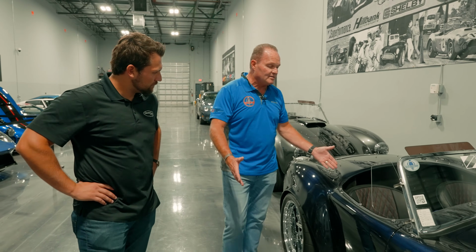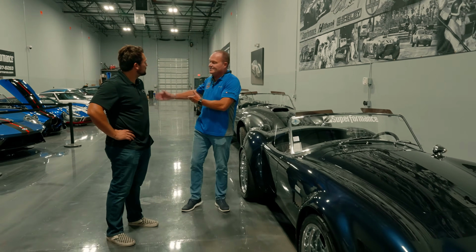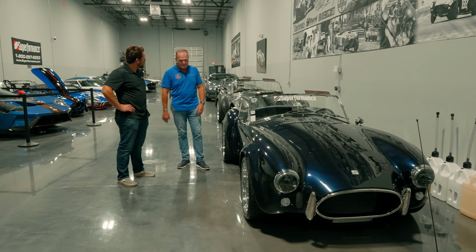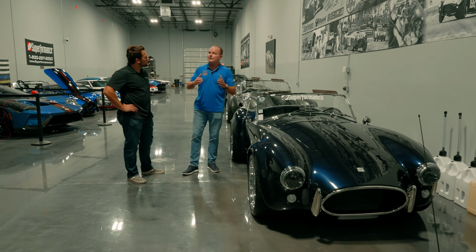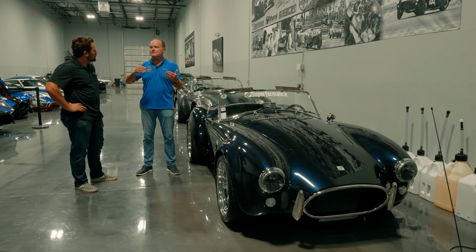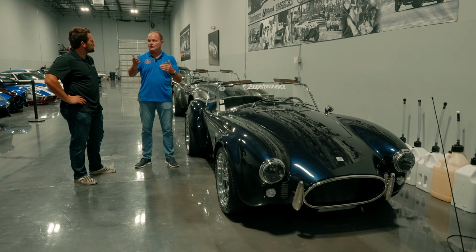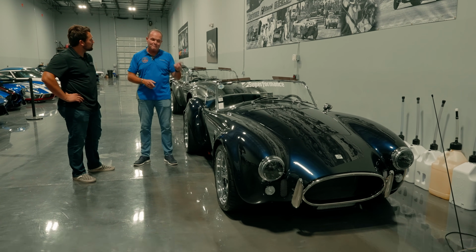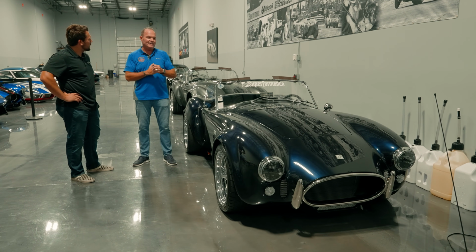And it is to date the fastest car 0 to 100 that I've ever driven. And I've got a Ford GT. We had a 1,500 horsepower twin turbo Cobra that we built for SEMA one year. That car was also making close to 1,000 pound-foot of torque, but it was making it at 4.5, nearly 5,000 RPM. It's really high up. It was a Coyote-based engine. This car makes it from 1 mile an hour. From 1 mile an hour, it's making 1,000 pound-foot of torque, and people have a hard time understanding that.